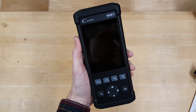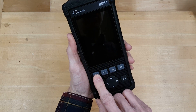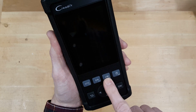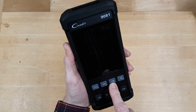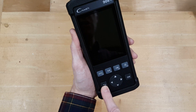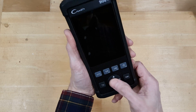Here on the bench I'm going to use USB to power it up. It comes with a nice big screen — about a four-inch diagonal — and it's got a screen protector we can peel off. There's a row of quick-access buttons: one for quickly reading diagnostic trouble codes, one to erase or clear those codes, and an IM button for inspection and maintenance. This will run all the functions and tests that your emissions testing station is going to run, so you can see whether you're going to pass your smog test. There's also a general help button, a back button, an OK button, and navigation buttons to scroll through menus.